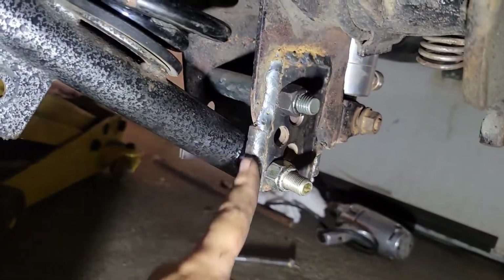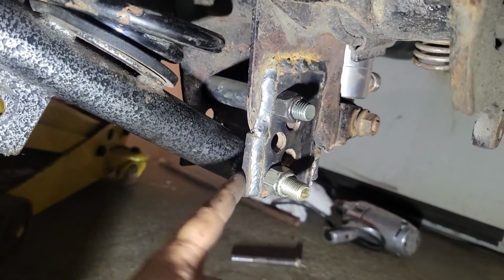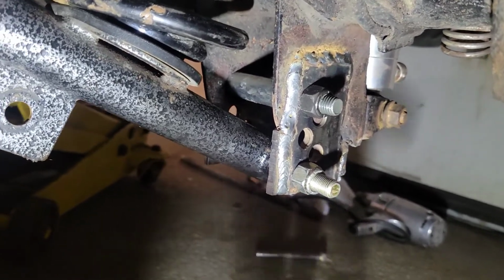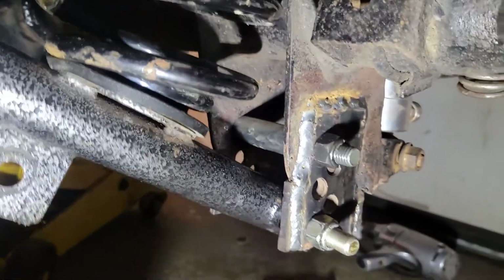It's all done. Got the things welded up, 3/8, or not 3/8, well, it's about 3/8. It's a 1/4 inch plate here with an 1/8 doubler. Did a reinforcement of the top, bolted it in, make it a little more rigid. And then we reinforced the back.